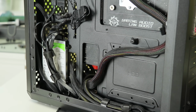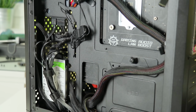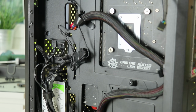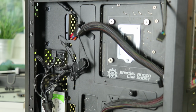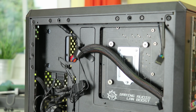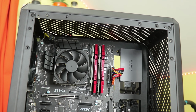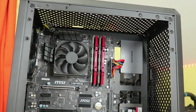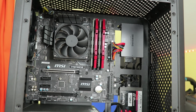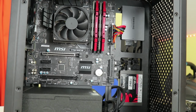The only potentially messy part of this cable management was the SATA data cables that needed to make a short turnaround and had to be bundled up and strapped together to use up the excess. You may also notice the random power cable making its way up the side of the case and through to the other side of the motherboard tray. That's to power the LED strips later on. Normally it's an installation that is an afterthought, but it was all too easy to do in this case. This is such a clean and easy build so far thanks to that impeccable cable management space.